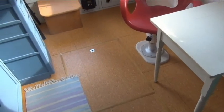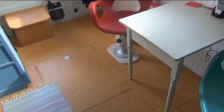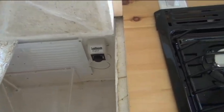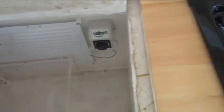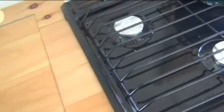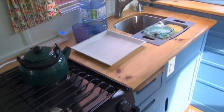I've cut some more hatches into the floor, basically for access — underneath here I have wires and so on, and it's good to have access underneath. The fridge — I'm quite happy with it. It was a really easy build in terms of taking existing styrofoam and using very thin acrylic plexiglass to cover it with adhesive, to make the inside. Very well insulated, keeps everything cold. I got a little Isotherm compressor system. In Canada they're asking about $1,300 for the system; from an outfit in England called Supermarine Store it was $600 — worth the shipping, a good saving.